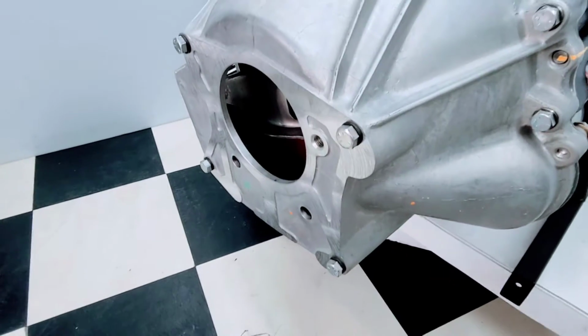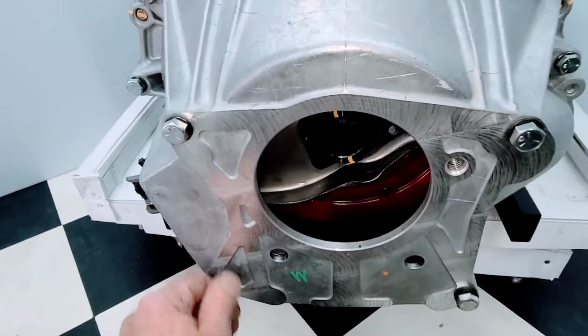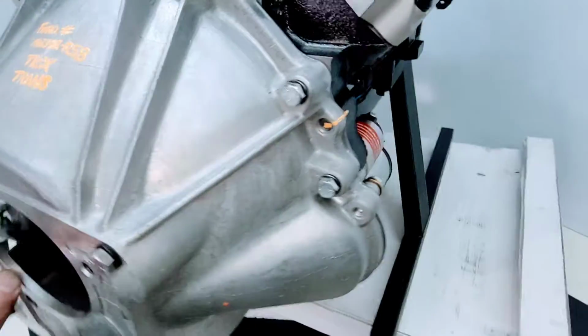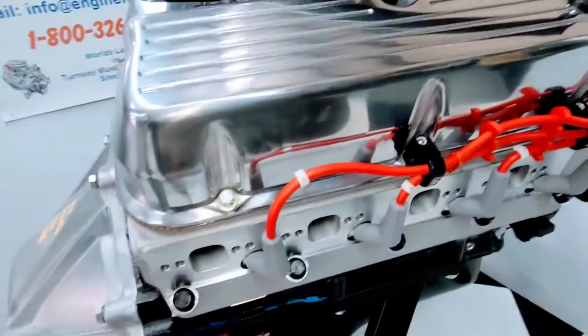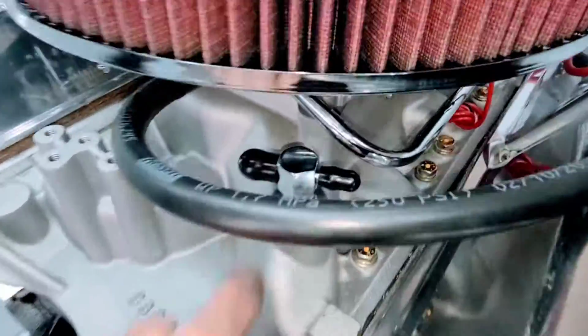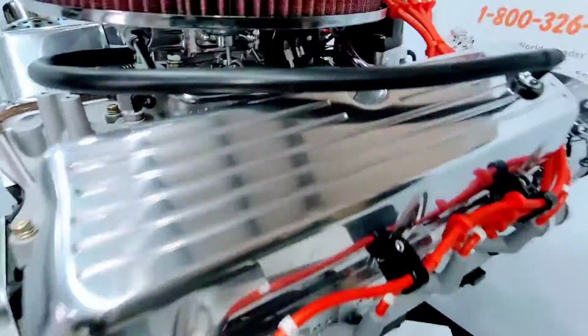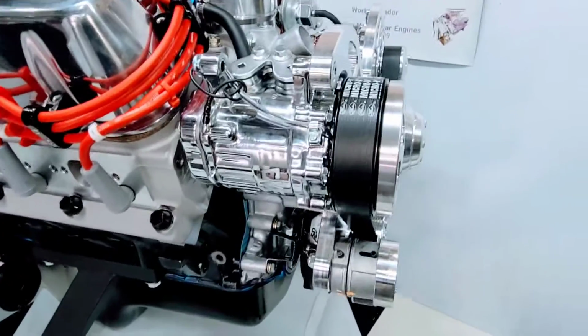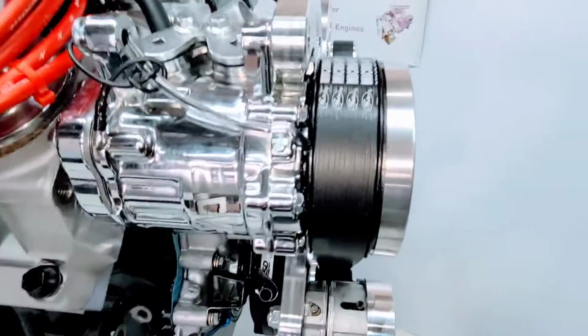Supplied all the transmission bolts. Clutch is aligned, throw-out bearing, clutch fork all set in place. High torque mini starter. PCV ventilation line, Russell heavy duty. Manifold vacuum fittings installed for easy hookups. Electric choke wire. It's real nice polished Raptor pulley kit. Heavy duty 8-rib serpentine belt.